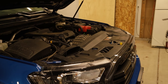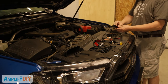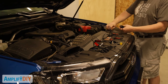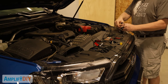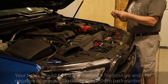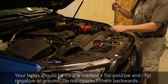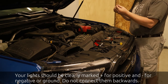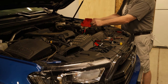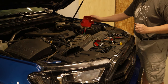With that soldering done, the next thing I'm going to do is test to make sure that all the lights turn on. It would be best to do this with a 12-volt power supply rather than straight off the car battery — I don't have a 12-volt power supply other than my car battery, so be careful when you do this; these batteries pack a punch. Make sure you're keeping straight negative and positive on these lights. They've wired it so that the stripe on the wire is positive and the one without the stripe is negative. I'll touch the negative first and then touch the positive — looks like they work! With that test out of the way, I know I wired them correctly.